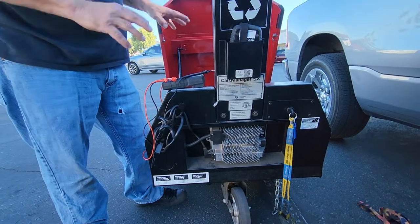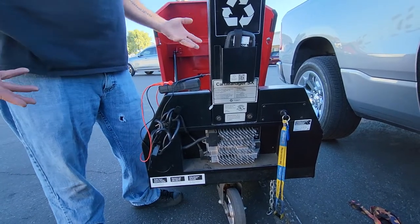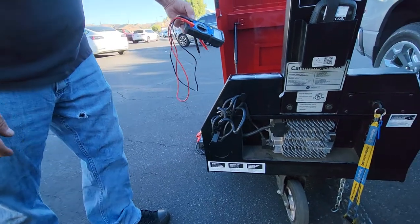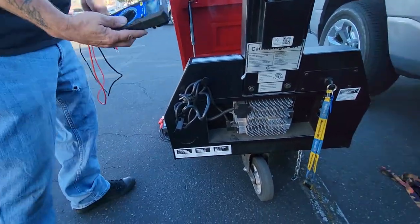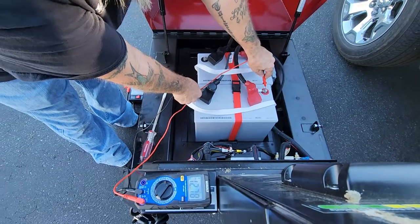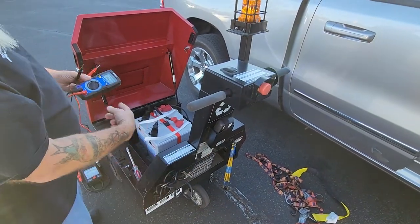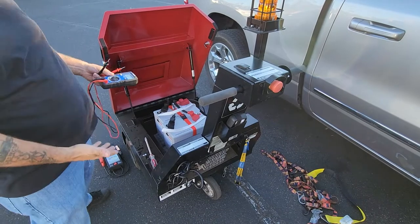There's been a CM XD model — we've only seen one so far. If you run into a CM model, it's going to be the same test, but the part numbers will be different. You'll have to call to get the prices and part numbers — call me, Willie, or Tony. Testing the charger is the same as electric carts. When testing something at 12 volts, you can't have it set at 2 volts — you need to be above 12 volts. The battery is holding at 12.78 and the other at 12.73. If you plug it in next to an outlet and those numbers start to climb, that tells you the charger has thrown amperage to the batteries, so the charger is good.